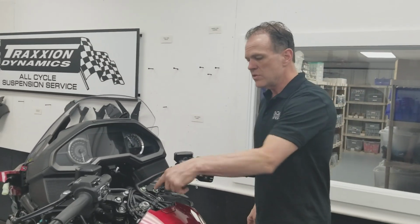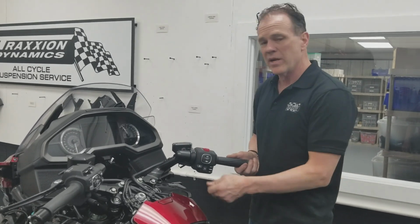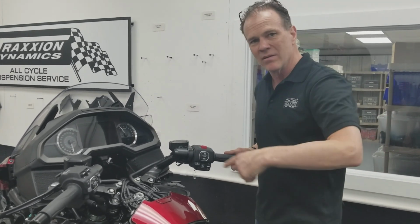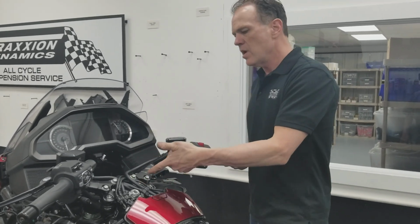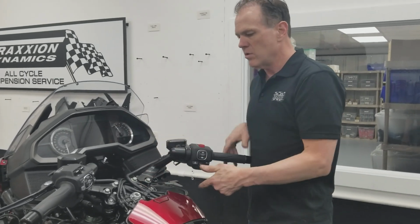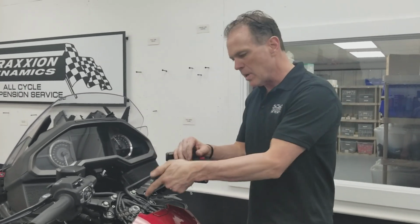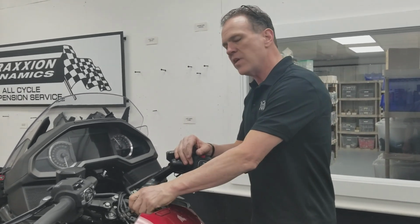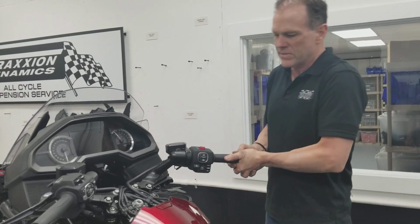And so just know when you try and tighten it, you're going to go, oh no, I'm stripping it. But you're not. The spindle is just spinning, and so then you'll have to take an air gun, put it on there, and just bump it. Don't try to damage it. You just want to bump it, bump, bump, bump, until the thing seats and is as tight as it's going to get. So now look, this bike is fixed.